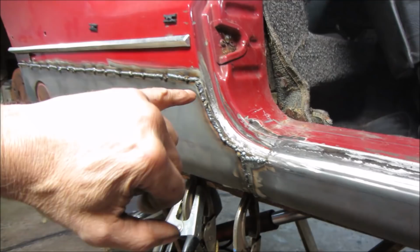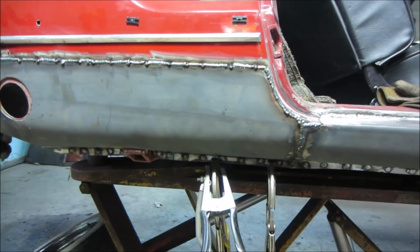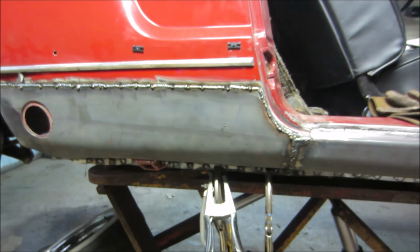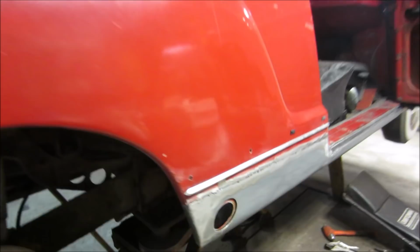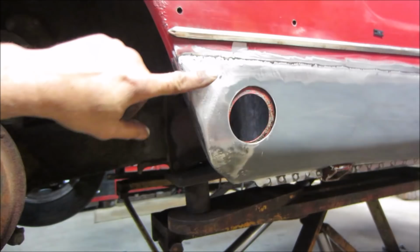It's got leaded in seam somewhere, because lead started. I kind of wiped it with my finger to kind of make it smooth again. All right, let's go with the flapper disc. Smoother out. Smooth, I say. And then after it's ground, I think we will be just fine. And once we put a little Bondo over it, it'll feather out just nice. That gap feels good going across there.